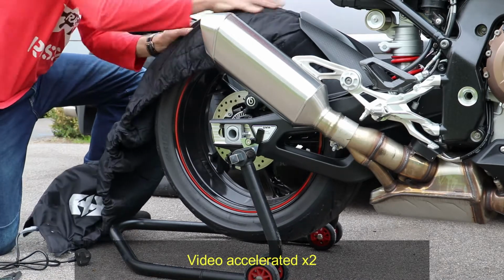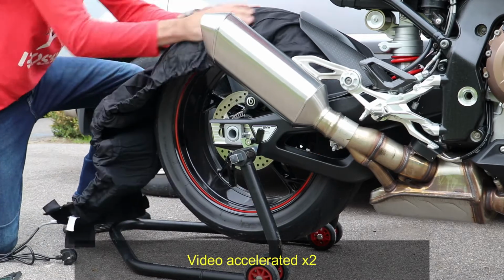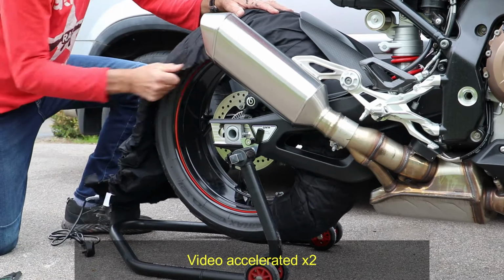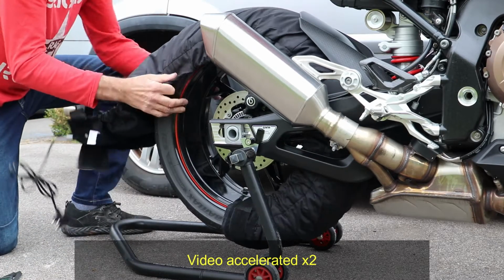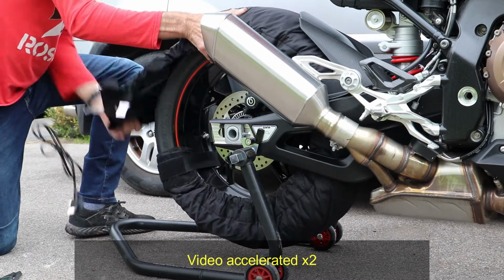It is important to get the warmer quite tight against the surface of the tyre, not least as we don't want an air gap to act as insulation, but also to allow it to fit under the mudguard, in this case a rear hugger on mine. By rotating the wheel, the warmer can now be fitted all the way around the circumference.